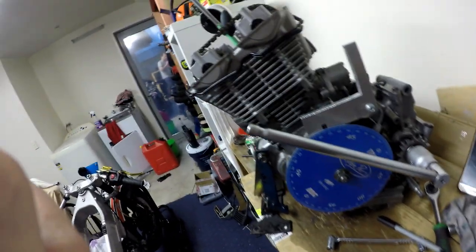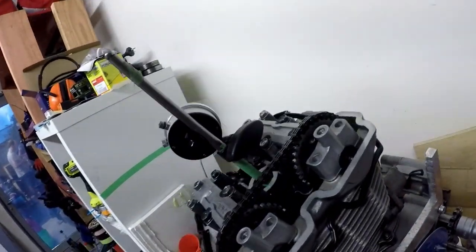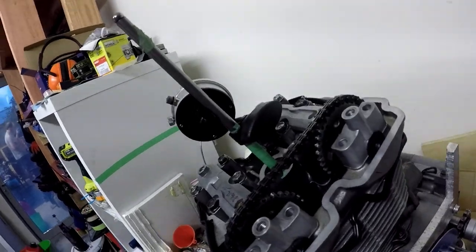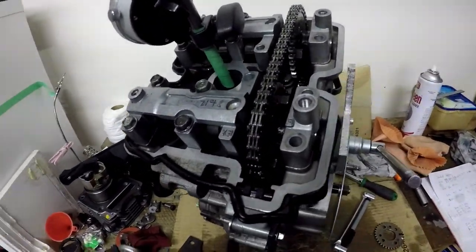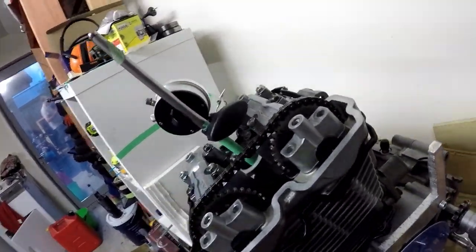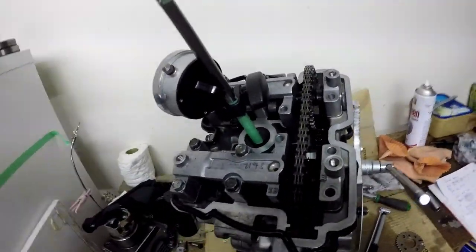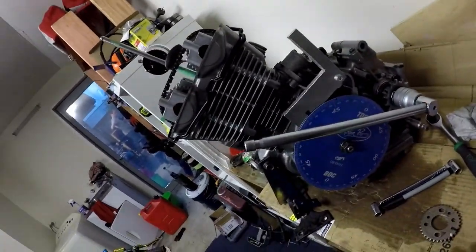After a lot of maths I've figured out whereabouts our cams are timed. According to my calculations the intake cam is pretty much bang on where we need to be as far as timing is concerned, but the exhaust is not opening early enough — it's eight degrees out. That was just on standard timing, so I'll take it apart, swap sprockets, and see how we go.